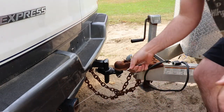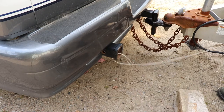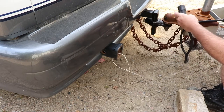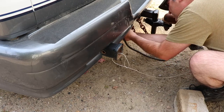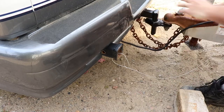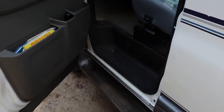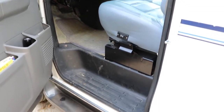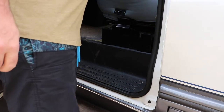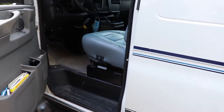So you loop it through over here — that's what I did before. This receiver is handy where it's located but it can be hard to get a good connection. The best way to find out if you got a good connection is just to go and take a look at the brake controller and it'll tell you if you're connected or not. It says 'C' on it right now instead of two dots — when not connected you'll see two dots. Then you can pull the brake — getting about seven amps right there by pulling on the lever. So then you know you're hooked up, and you just check your lights obviously.